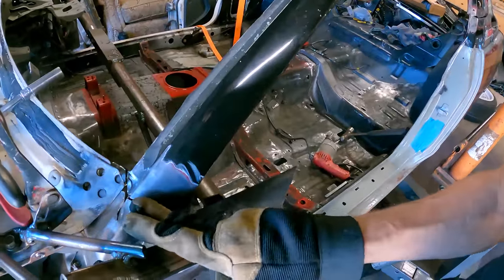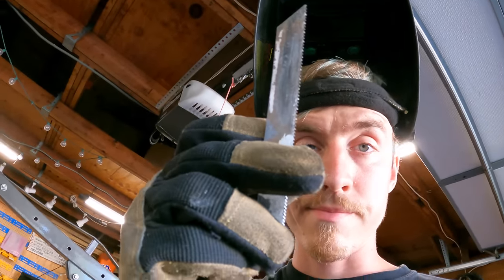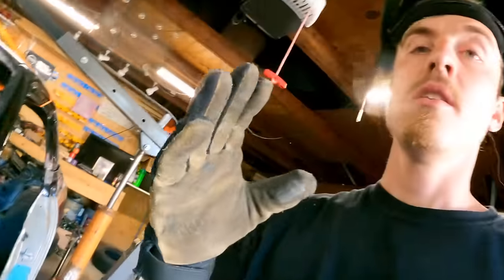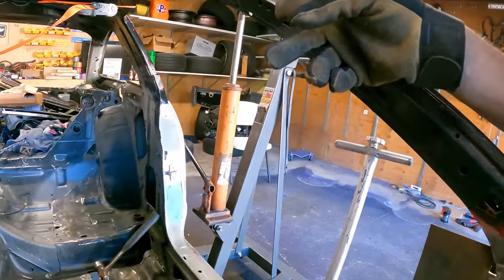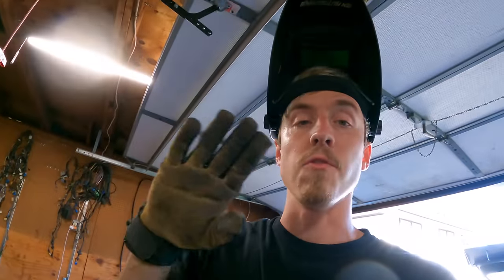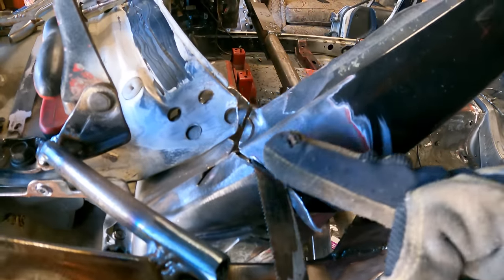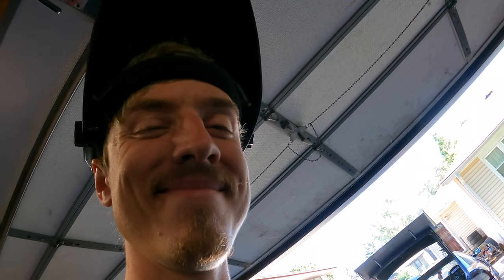When I cut this roof off I used a sawzall, so the gap between the cut ends is at least one sawzall blade's thickness. If I wedge the blade in between here, it'll be at the original distance — there will be a gap to fill in, but right now I'm just tacking. What I plan to do with the A-pillar and B-pillar later is take off the backing plate so I can reinforce everything behind it, because just filling in a gap isn't going to be enough, especially since I can't get to the thickest piece on the inside. Is this really the first weld? I can't even believe this — I'm already starting to weld.